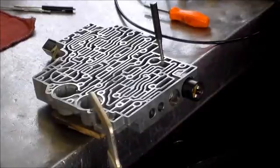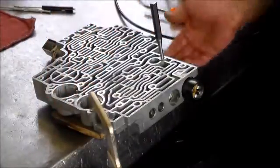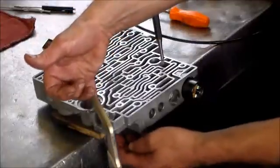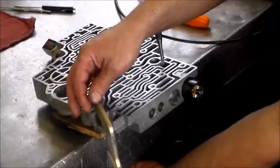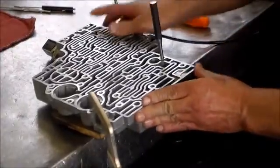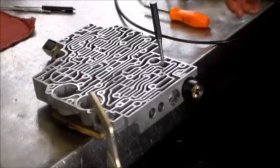I got this thing anchored to the bench. Under here I have a piece of wood going across almost the length of the valve body so everything stays flat. I have large vice grips in the accumulator bore where the spring goes, clamped to the bottom of the bench so the valve body can't twist. I have one of my punches in this way, so this thing is pretty solid. Now we're going to get set up to ream this valve body out.